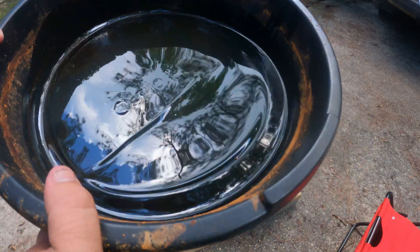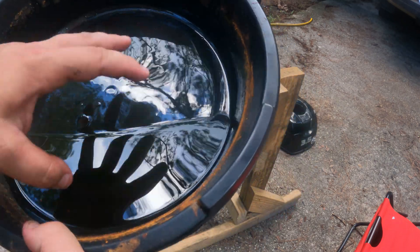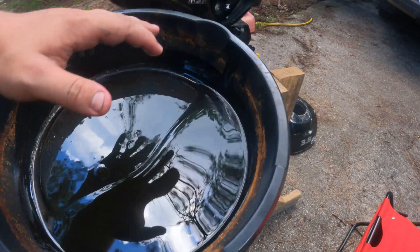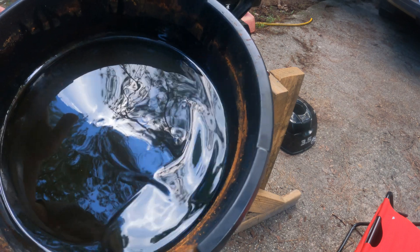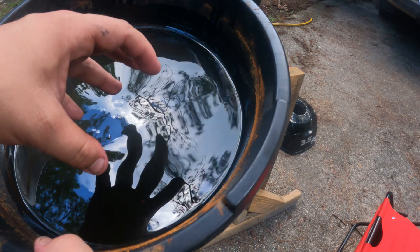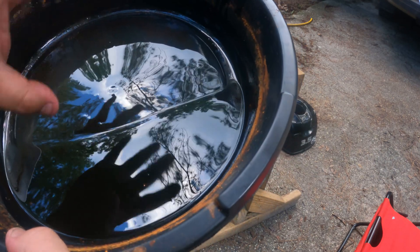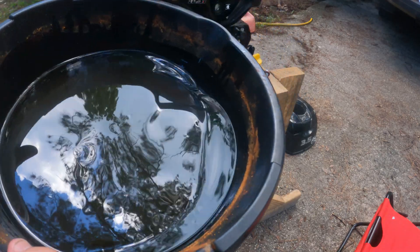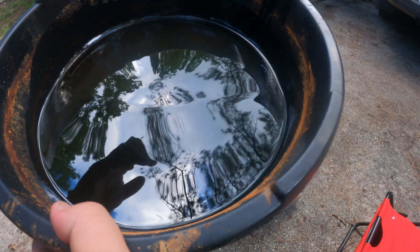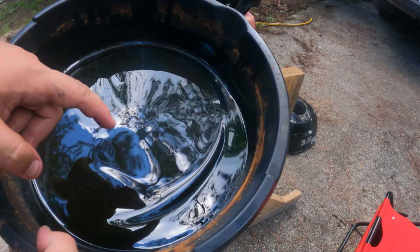With the oil changed, I'm going to do a quick visual inspection. I do have some foreign material in here from previous projects in this oil pan, but I'm looking for metal flakes. Small amounts of metal flakes is fine, especially since we don't have a filter on this engine. However, if you're seeing larger chunks or a significant amount — like your oil is almost glistening like silver glitter — then you might have some other things going on. In this case, the oil is looking great. I see a few small metal particles, but that's just very light engine wear. Color is decent as well, not too old.